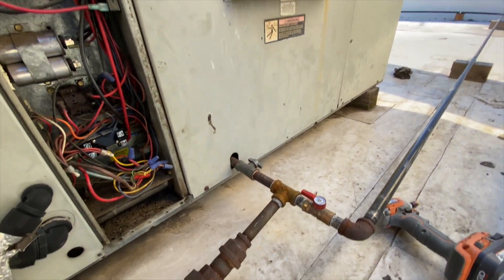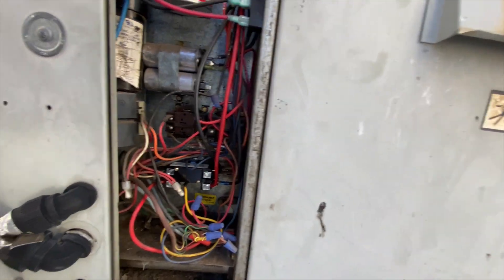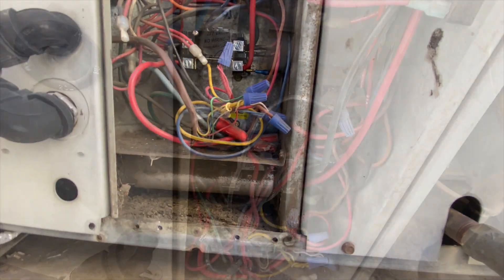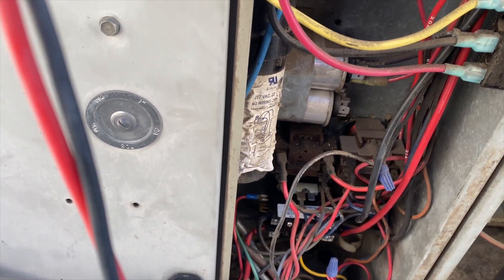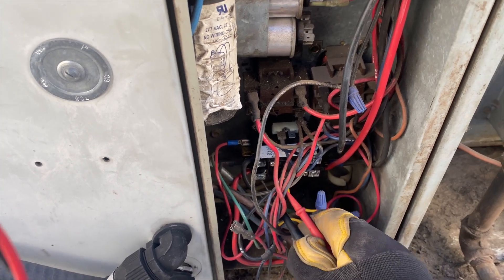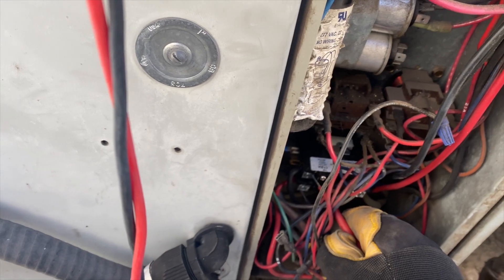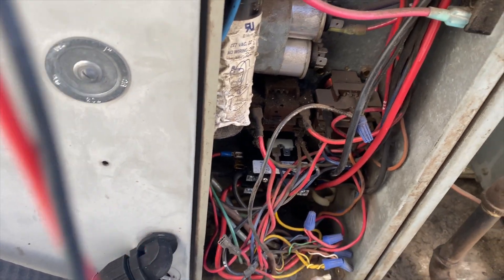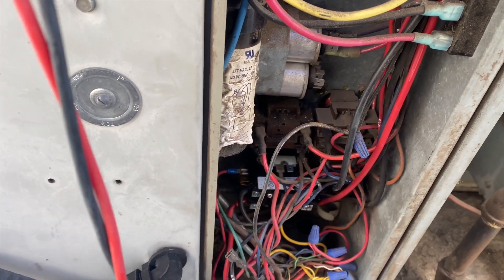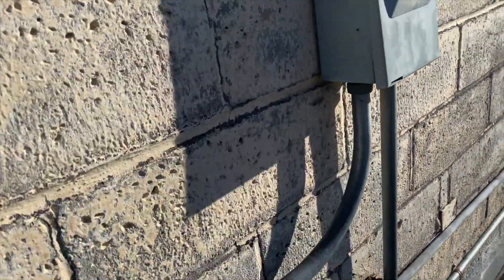We'll go ahead and do our obvious visual inspection. I have the transformer taken out of the circuit — going to go ahead and test it. I'm not getting any continuity between line one and line two anymore, so we're going to go ahead and plug her in and see what happens. Hopefully I don't pop the fuse again and nothing's touching — let's try this again, otherwise I'm going to have to go all the way back down there.